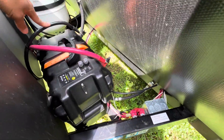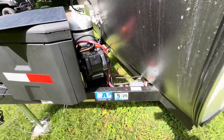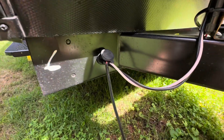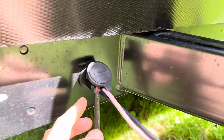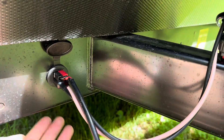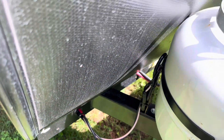I had another 100-amp-hour lithium battery and went ahead and put them in parallel, so I have 200-amp-hours. I fed that through here with some 1-gauge wire, then drilled a hole underneath into the under-storage and set up the other battery system. I also got rid of the old SAE connector for solar and put in Anderson connectors — miniature Andersons — for external solar to charge my battery. I have a folding solar panel to charge up the 12-volt if needed, or I can use the converter that's built into the breaker.